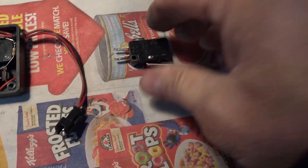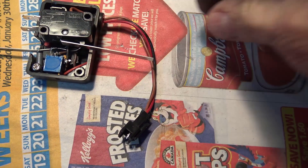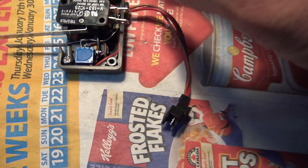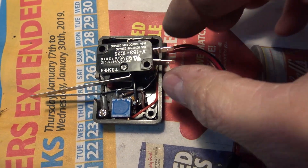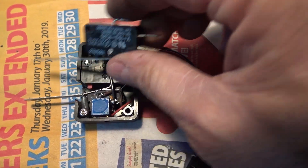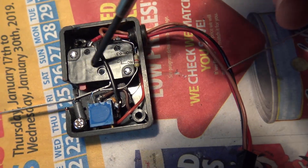This is what I have purchased — it's pretty well an exact copy of the same switch, and it's going to go in just like that. You have to cut off the contact points so it fits in the case, then re-solder all the wires. That's what I'm going to do right now.